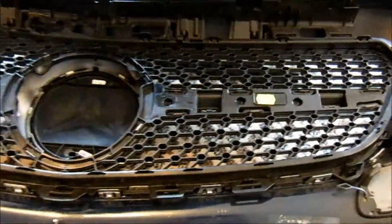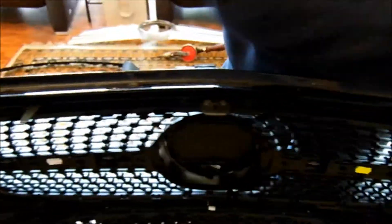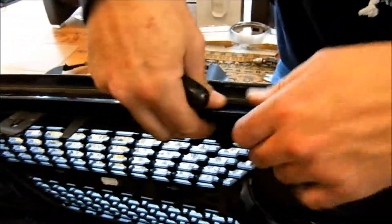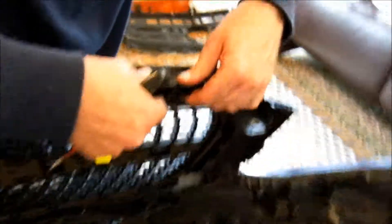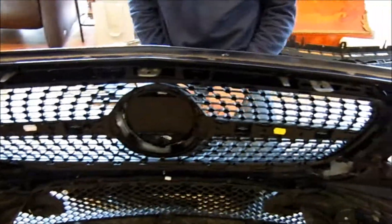Before you take the chrome off, you've then got to replace this weatherstrip. This weatherstrip sits on there like that — it's a very simple fit. You can either run it down like that or just push it down and feel over for it. Now up here are those four rivets I was talking about that you need to drill out. Because there are these little bits in here and all this is held together by the car, I'm not actually going to replace those rivets because I don't have a rivet gun. But if you wanted to, you could put a self-tapping screw in there or you can rivet it. Once this is on the car and the crash structures are in place, it's all squashed together anyway so it's never going anywhere.